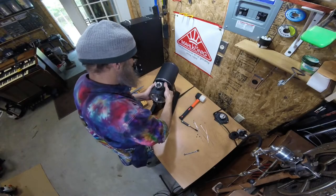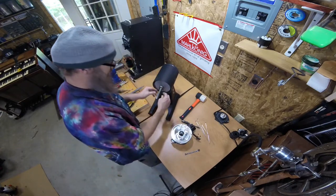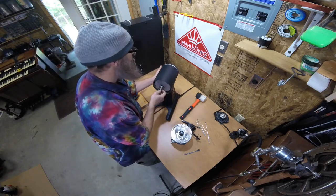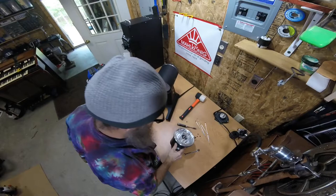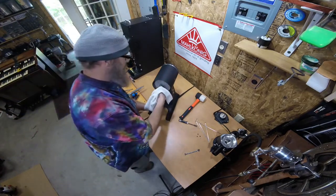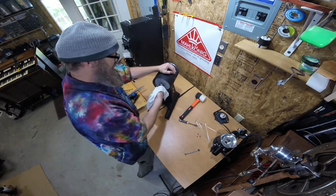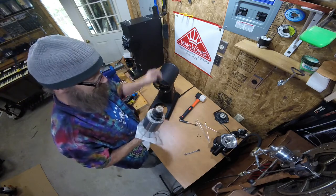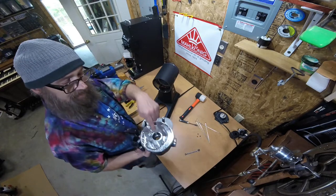To get the bearing out of the back plate, a method I've come to like: I push back on the shaft and then pull it forward like snatching a tooth — that snatches the bearing out of its seat in the back. When you pull this out, notice there's also a bearing on the front which rests in its seat on the grind chamber.